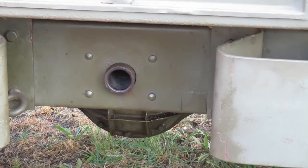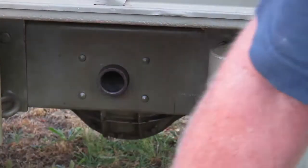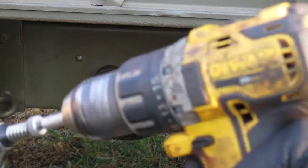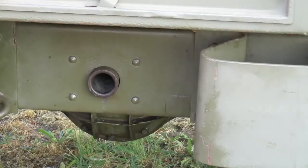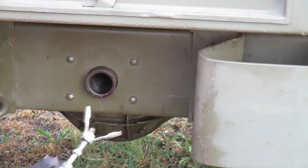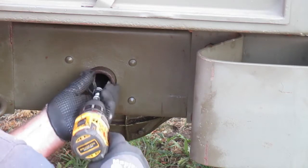All right, so I checked the shaft of the Pintle Hitch, and it's straight and true. So I'm thinking I need to get more rust. Here's what I'm using. Let's see if the camera will pick this up. It's just a wheel cylinder hone. And then I have a combination of WD-40 and Marvel Mystery Oil, and a little quart bottle here. Did a great job. But I guess I need to get more rust out of here.